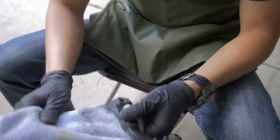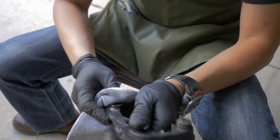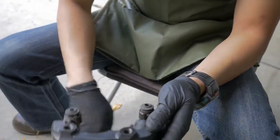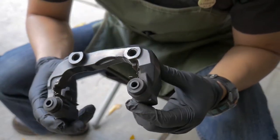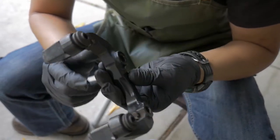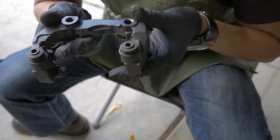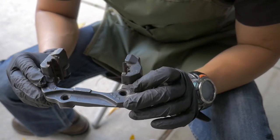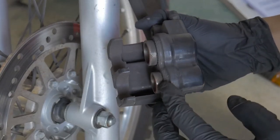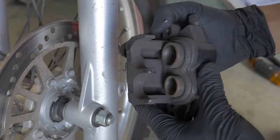Now that we've got it sprayed down, I'm going to go ahead and wipe it down with a cloth to make sure any extra brake buildup is taken off — it's that attention to detail you want when working on your own bike. Now it's all nice and clean; we've cleaned out the channels and the clips, so we're more likely to have a quiet set of brakes. The factory service manual does recommend changing both spring clips inside the brake caliper bracket. Now we're going to clean up the brake caliper as best as possible, getting our pistons clean to make sure they're moving freely and we don't get any extra debris into the system.